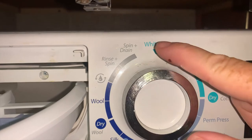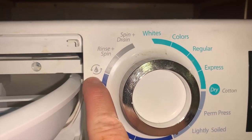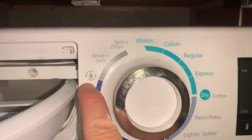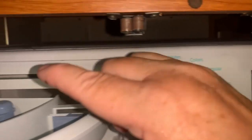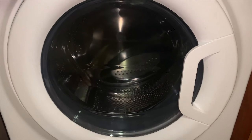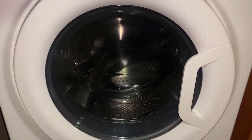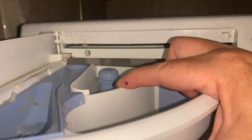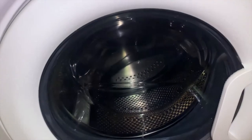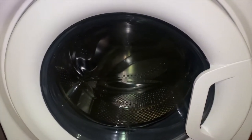The only time you use bleach is when you are cleaning your machine out — I'll put the link above on how to clean your machine using the clean cycle and bleach. The only other time you'll use bleach is when washing whites, and you put your bleach right here in this compartment. Just a warning: Splendide says never ever use dryer sheets in your Splendide washer. Also, Splendide says not to use splashless bleach — this will suds up in your compartment, creating a lot of damage. Refrain from using splashless bleach.